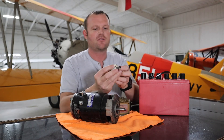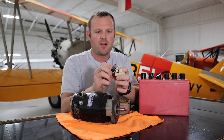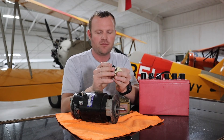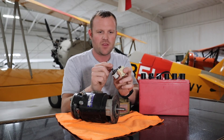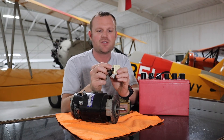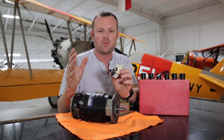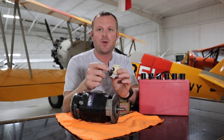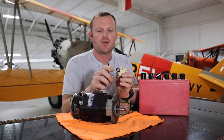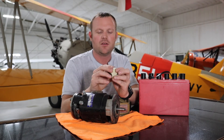The last piece of the electrical system is the circuit breakers. The most common issue I've had flying airplanes is with old-style lights — sometimes there's a problem with the bulb and it pops a circuit breaker. Instead of a wire heating up or catching fire, the circuit breaker heats up and trips first, protecting the wiring. Always check your circuit breakers if some item isn't working, like a light or radio.